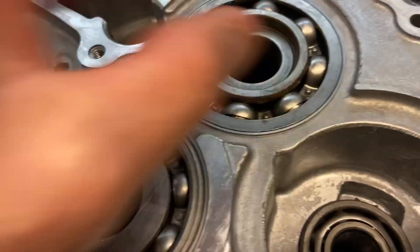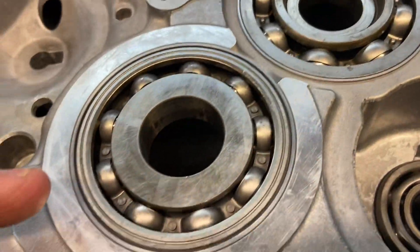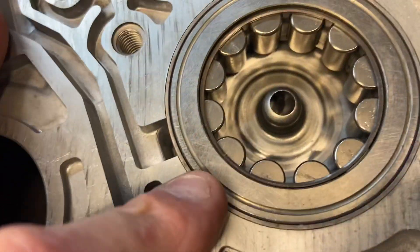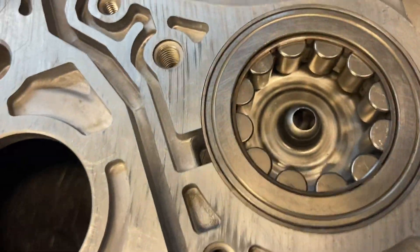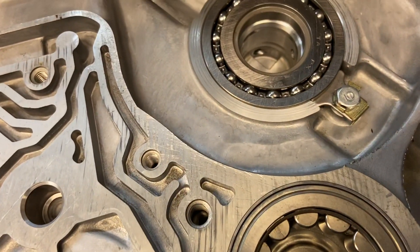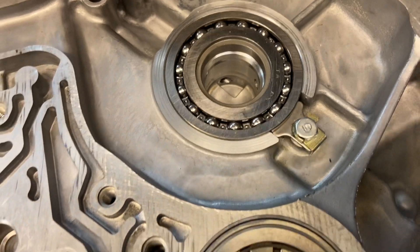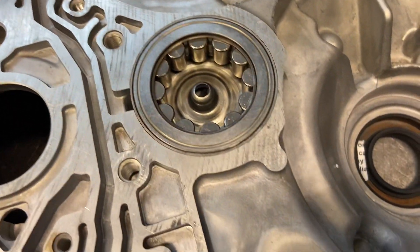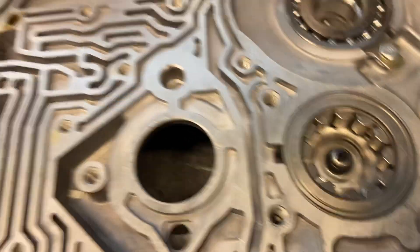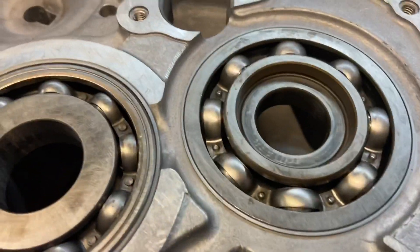This ensures that the shafts and the relationships between the shafts are correct. On the other side they do the same thing. These shafts actually go through a regulator body as well, so if the shafts aren't being supported correctly, it will chew up the ring lands in the regulator body. The problem is, if you replace the regulator body without re-establishing the bearing fitment, you'll have a repeat occurrence of failure.